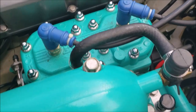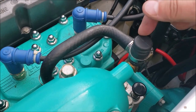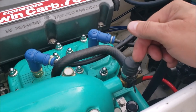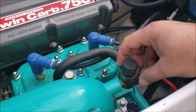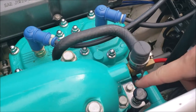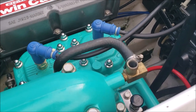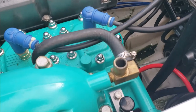That's what keeps it quieter when it's in the water. The purpose of this video is to show you where you hook up your water. On these specific jet skis, we didn't add this kit — it was already on them. Basically there is a nozzle here. You loosen this pipe clamp, pull it up a little bit, and there's a little rubber clasp. You undo that, pull this off, and you've got this nozzle. I cranked it up just a minute ago but it's smoking a little bit from the exhaust — that is where you would put your water hose fitting.